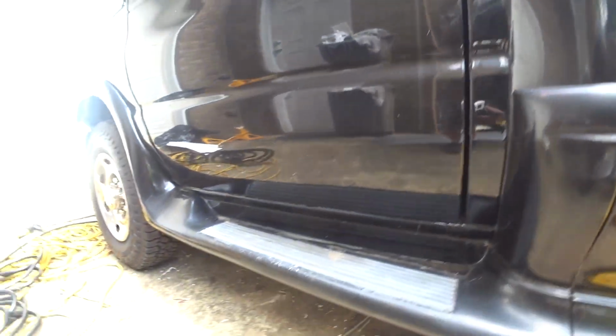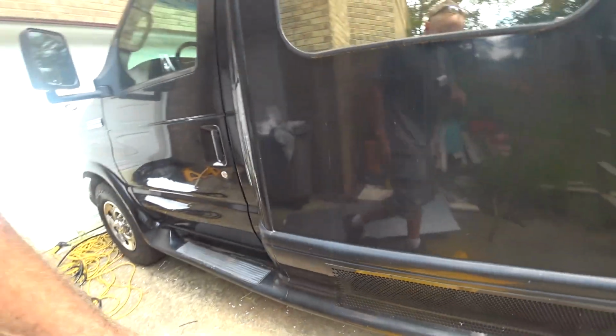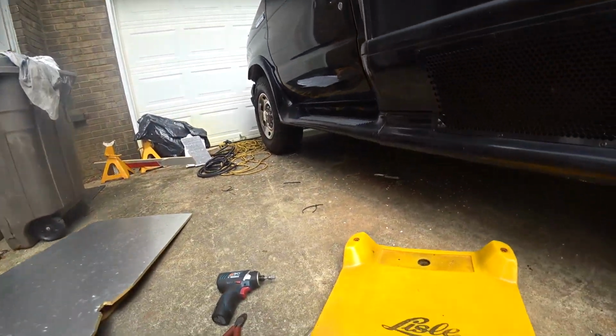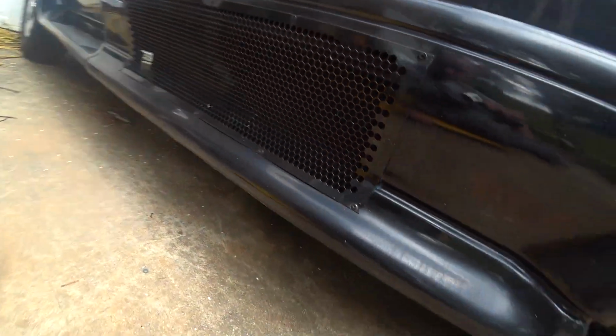Okay, so I got the rest of the air conditioning all fixed up. It's charged up in the front, put a condenser in it, ready to go. Now, got to remove this old condenser and air conditioning unit under here. Got a lot of interesting things to keep, but it gives me a little extra space in here, so I'm gonna strip these lines and take the whole unit out and lighten it up a little bit.